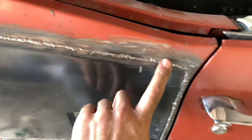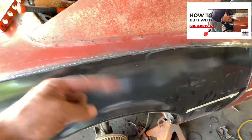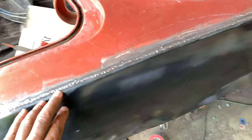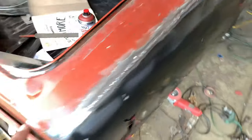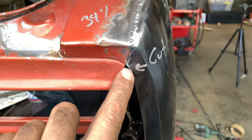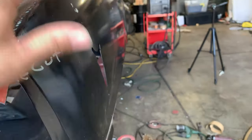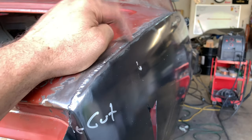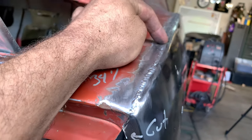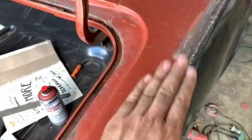About eleven billion hours later, I've got it all stitch-welded in, all happy, and looking pretty decent. If you want a video on how to do this butt welding, I'll do a close-up video and release that later. This is how to get the quarter panel put on, how to get it test-fitted, and why we do it as a butt weld instead of an actual lap weld replacing the whole thing. Back here in the rear I'm not going to weld this yet — I want a little bit of adjustability when I go to put the tail panel in, since I already had to cut this to change the dimension. This is a repop panel so it isn't perfect, but you can look down the side of the quarter panel and it doesn't warp with this technique. Very minimal filler if anything is going to be on this face.